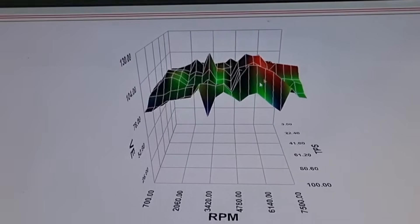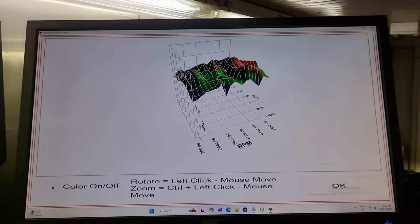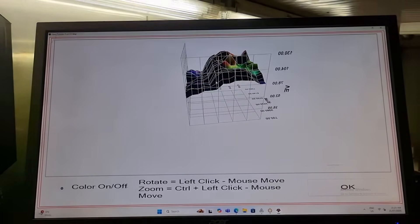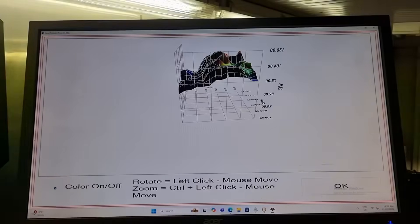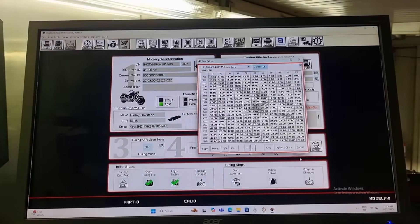Again, a lot of fuel right here where the mouse is — that's got to be taken out, there's way too much up here. Again, this is all speculation: as long as the VE is true to the target, there's way too much fuel. I can just tell that already. That's not too bad there — there's a bit of a hole there. Anyway, let's have a look at the timing.